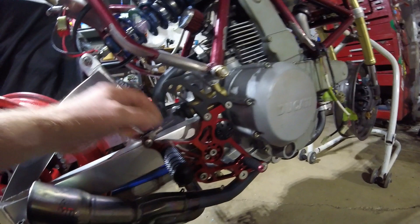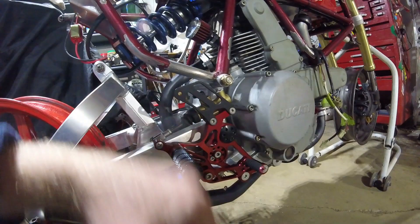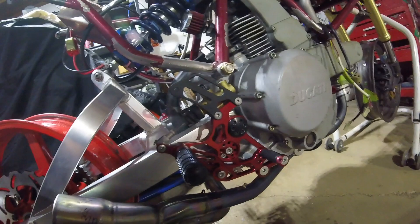On the right-hand side, the brake plunger works. I had to fabricate it a bit longer — it's just an extra M6 allen bolt, and I tapered the end to properly fit inside the plunger, so that works the way it should.